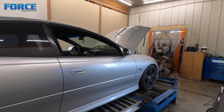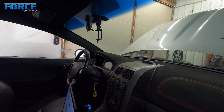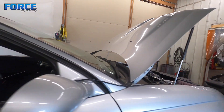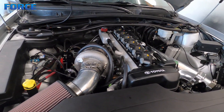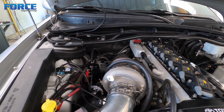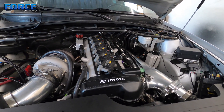Here's this GTO. It's a Haltech ECU car with an IC7 dash in it — I'll check that out more when we get over there. This thing is cool, man. It's super well done. 2JZ swap deal. It's got what I believe is a 7483 EFR turbo — I think those are the numbers for it. It's a 78 pound-per-minute capable charger.